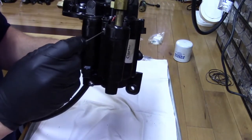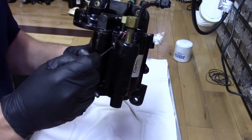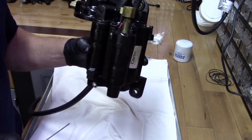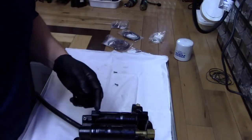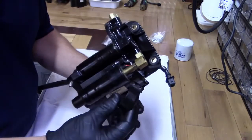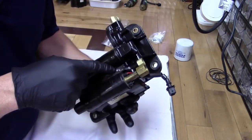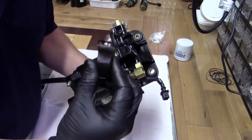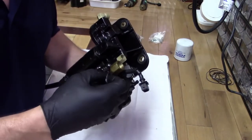Now what we're going to do is drill two little holes here on either side — probably only needs one, but we're going to do two. We're going to tap that out and get that fixed on there, and then this pump will be ready to go. I tapped out the new holes to hold the bracket on for the high pressure pump. The middle one, which usually has one in there, just had the head break off — that's really common. So I drilled out two new ones on the outside of that. This just slips down on top of there. Got two new stainless steel screws.